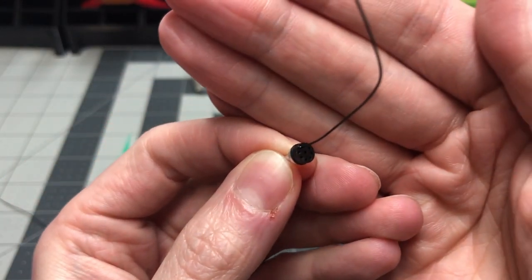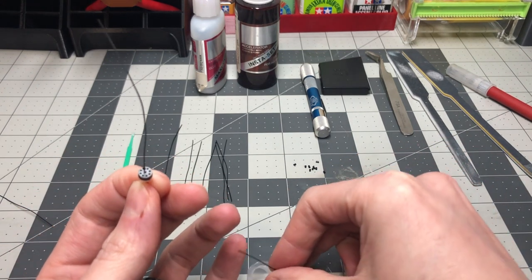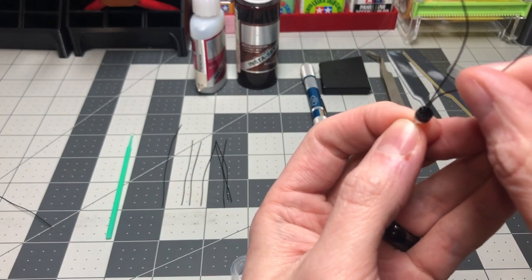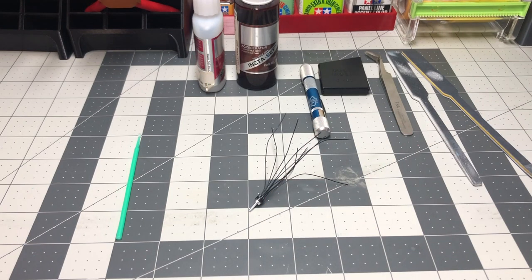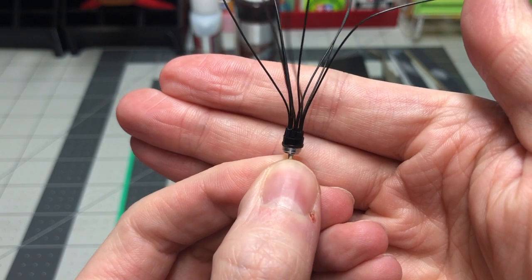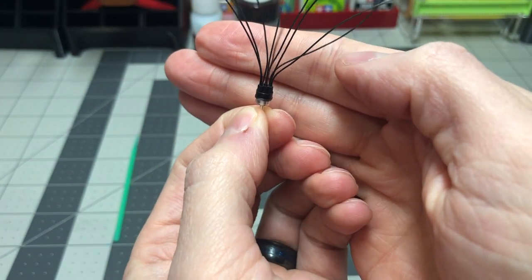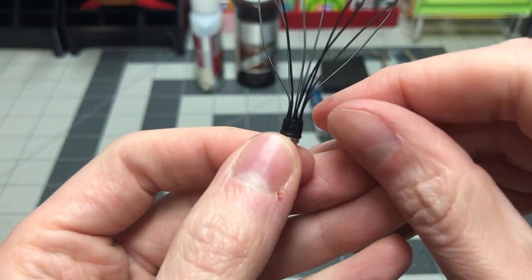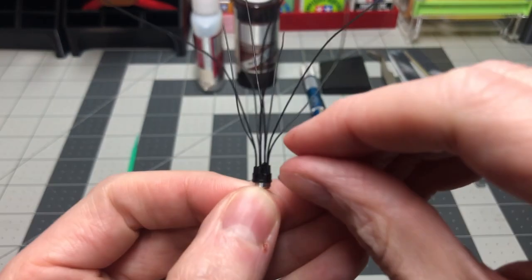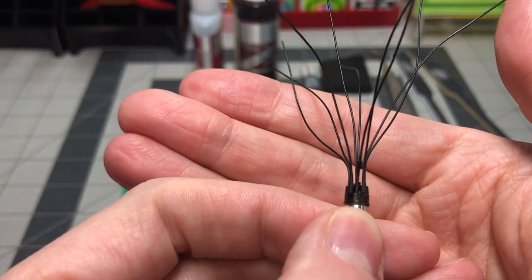If you have used any of Charlie's products in your build, comment below which products you've used and give me your opinion. Here is the distributor cap with all nine wires glued into the cap — no glue is showing as you only need a very small amount for the wires to stay in the holes. I placed the boots on the distributor off camera as it was hard to record while getting the boots to slide onto the wire. To glue the boots, all I need to do is raise the boot slightly, lay a very small amount of glue to the base of the wire, and slide the boot back down. And it's that simple.